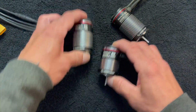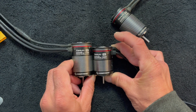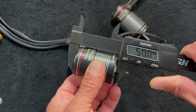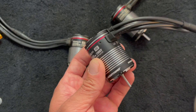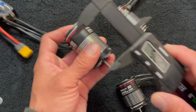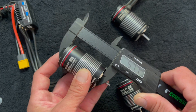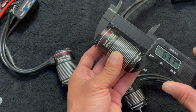We can get these guys side by side so you can see how much shorter it is. Just under 50mm — I think it's officially listed as 49.85 or something to that effect. It should be able to fit into the Capras and all those other tight squeezes really easily. The Vanquish Rig had an issue as well. As compared to the previous motors, this is the 540L at closer to 58mm, and the 550 version was a full almost 64mm.